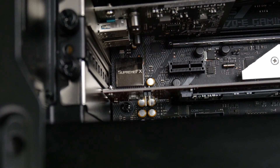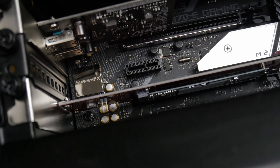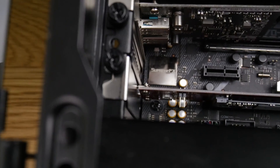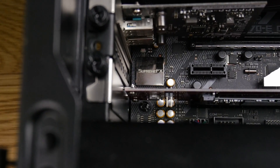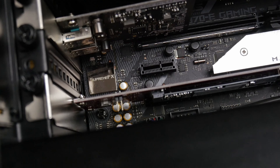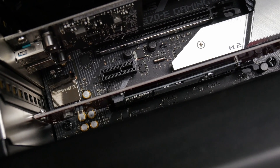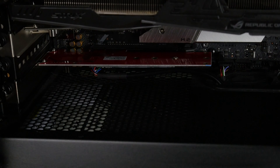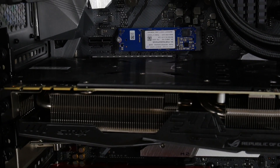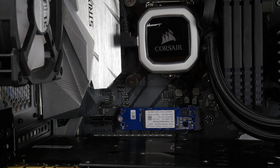This is the final view — I now have two NVMe M.2 drives installed on this motherboard, the Intel Optane memory accelerator, and two six-terabyte standard platter hard drives. It's worth noting that the accelerator will only work with one platter hard drive; I'm not sure if you could combine two to cover two different drives, but you download the software, assign your Optane memory accelerator to the relevant hard drive you want to speed up, and after a few restarts you get to enjoy the extra speed. It's not as fast as NVMe drives, but it does improve platter hard drive speeds. Hope you found this useful — please like, subscribe, and come back for more.